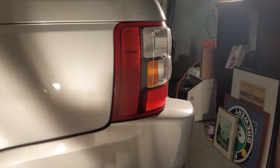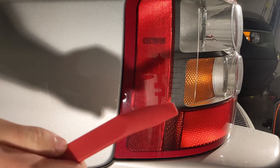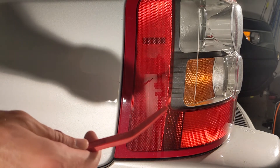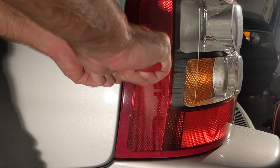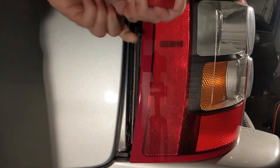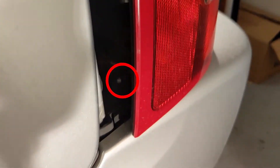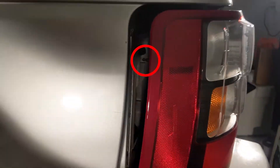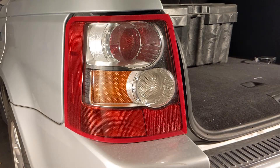Wedging out the tail light can be a bit tricky and requires a little bit of force. You will need to wedge a thin rigid item into the small gap between the body and the tail light, and slowly wedge the tail light towards the rear. Once released, you can take a quick look at the pegs that hold the tail light to the body. You could probably get away with using a flathead screwdriver, however you run the risk of scratching the paint due to the hardness of the metal.